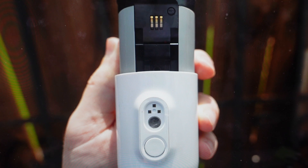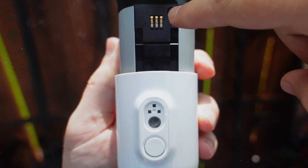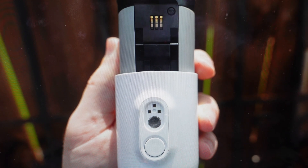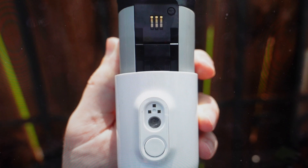All you're going to need to do is disconnect it from its mount so that you can access this button right here, right above the prongs. This is the sync button, and what you're going to do is press and hold that sync button for about 15 seconds. Keep an eye on this light down here, and when the light begins to blink in blue, you know that it's done and you can go ahead and release the button.